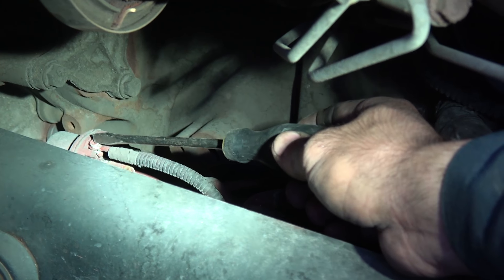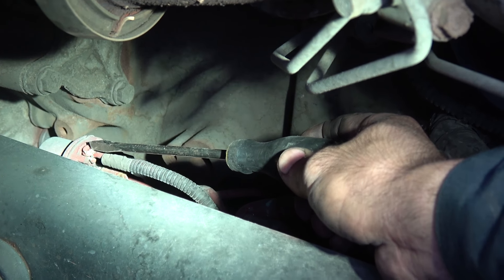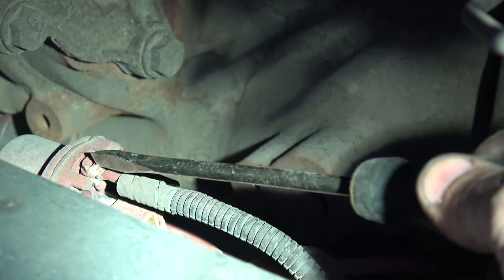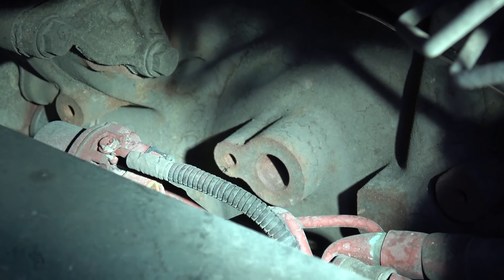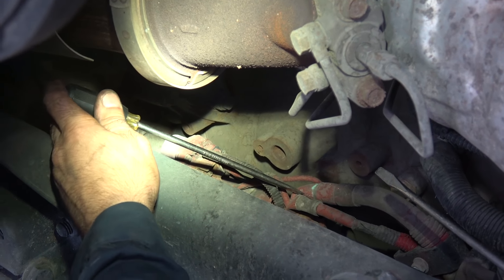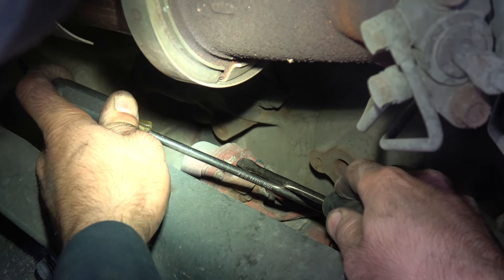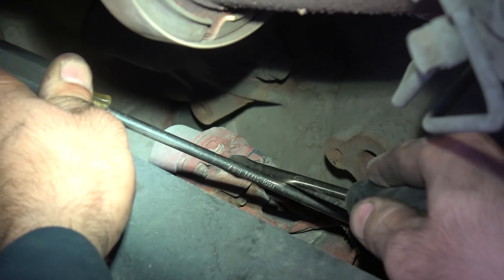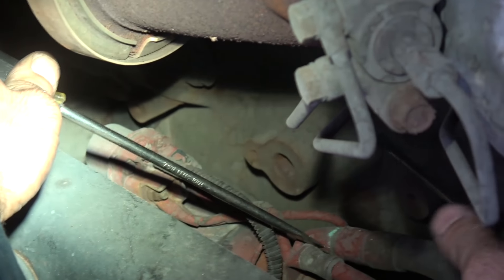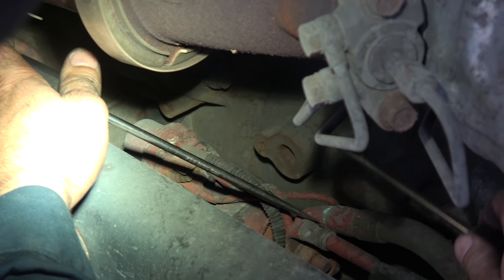On top of the starter, this is how you actually jump the starter — the actual term for it is shorting the starter, but some people call it jumping the starter. You have to connect one end of the screwdriver to that particular bolt right there, and with the other screwdriver you put it right in between those two points. Remember, never let the screwdriver touch the frame. Make a few contacts like this, and then attempt to start the truck.